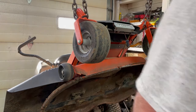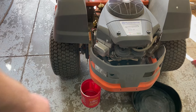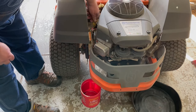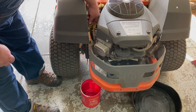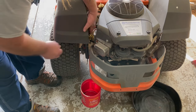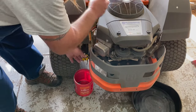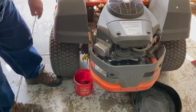Put the battery on, see if it's good. Okay, we're going to drain the oil on this Briggs. It says Husqvarna on the motor, but it's a Briggs motor — it's a 44 cubic inch. A lot of these motors have this drain assembly: it's a hose that hooks up to your shroud. Just pull it down, put an oil bucket under there, and let it drain. Put some weight on there like a hammer or something.